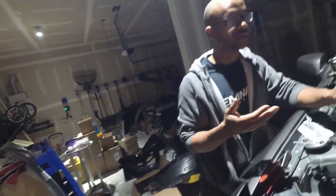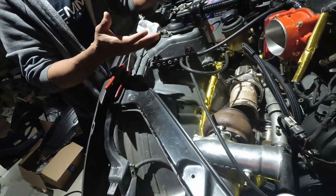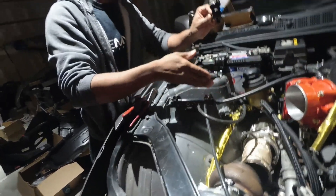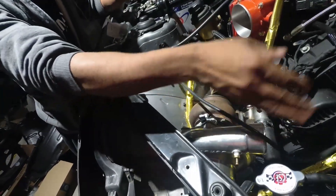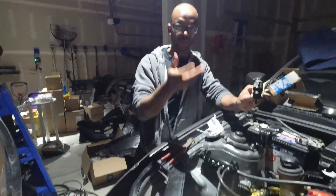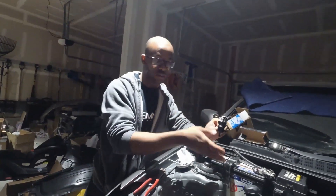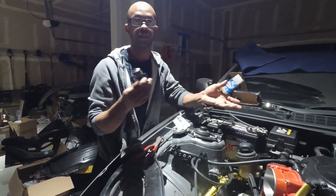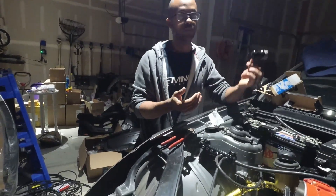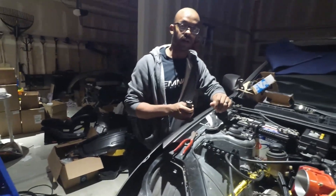So I think right now you guys have got a good feel for how to hook up your vacuum lines. It's not really hard — the hardest part is getting the vacuum block set up. You run that tee to the vacuum block, then one to your blow-off valve up front, one from inside the cabin for the boost gauge we installed before, and then one either directly to your wastegate or interrupted by a boost controller of some sort. Manual boost controllers all work basically the same way — interrupt the line from the vacuum block down to the wastegate. And that is the vacuum lines.